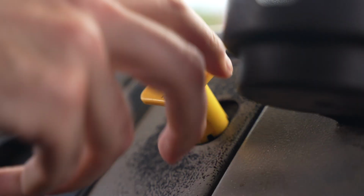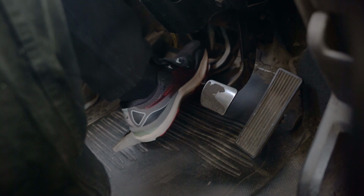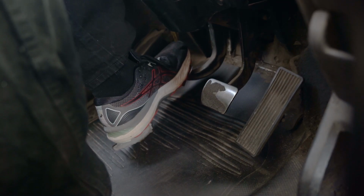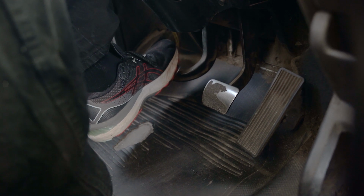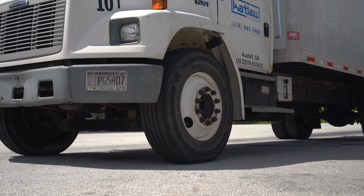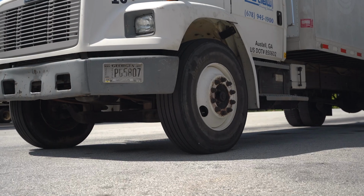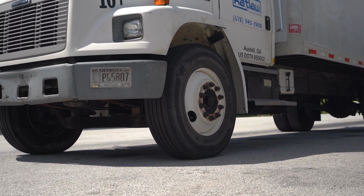Now I'm going to check the truck parking brake to make sure they are adjusted properly. You're now going to do a little tug in the truck by gently coming off the clutch. The key word here is gently. Now say, the truck parking brakes are adjusted properly and I still have sufficient air pressure to do my next test. Service brakes. Say, I'm going to drive no more than 5 miles per hour to check the service brakes.